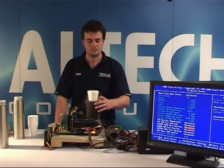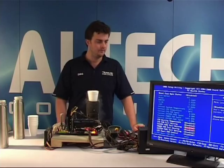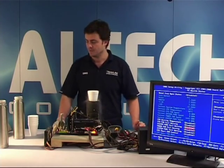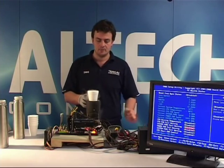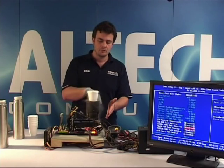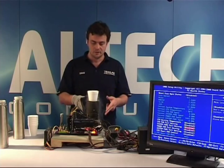With liquid nitrogen, depending on how humid the air is, you can also protect your motherboard further by getting a roll of paper and rolling it around the CPU pot. It's fairly dry here, but in case it is quite humid where you are, wrap some paper around, because all the water droplets will eventually go down and onto the motherboard.